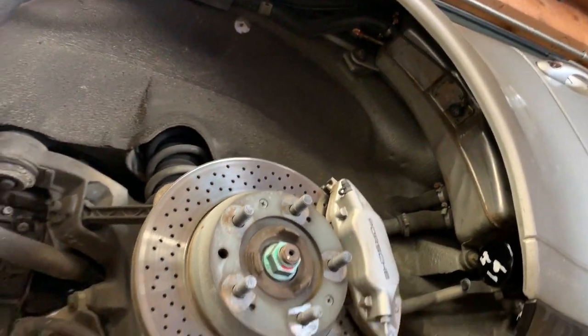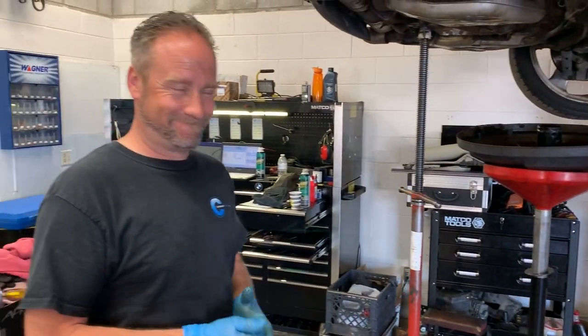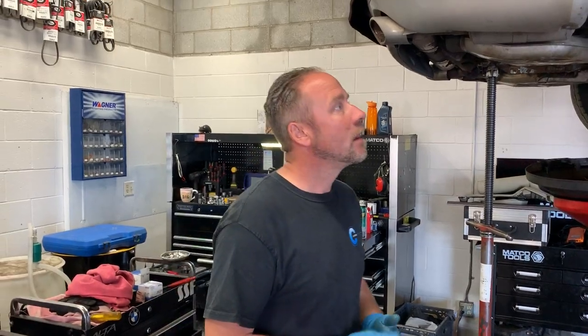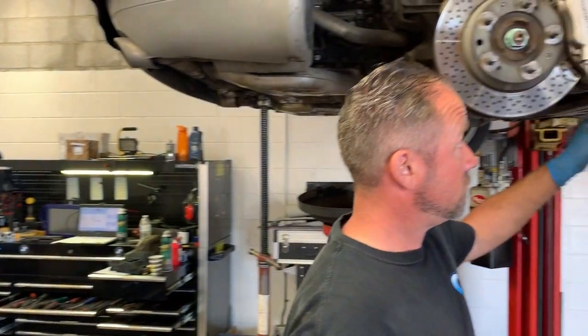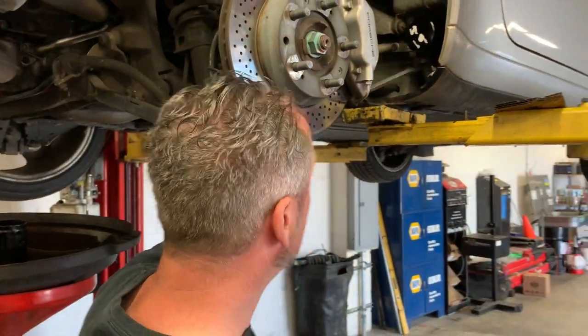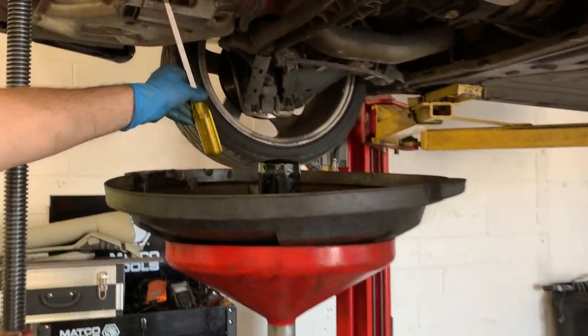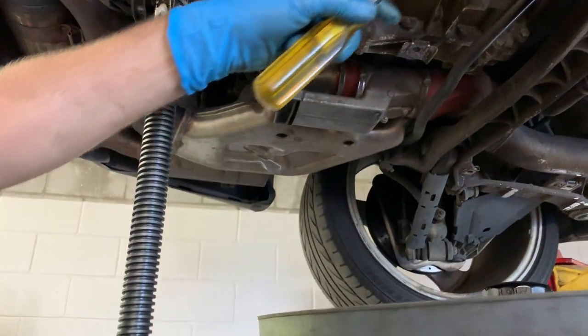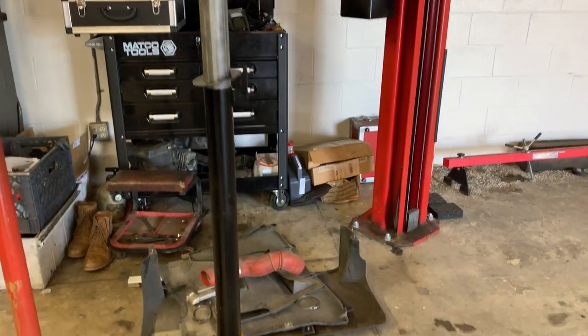To let us know more we have our German car expert Anders. It's very important that we do that external oil filter on the tank — there's a drain right there, there's also a drain on the actual engine right there. You've got to remove this pipe and the heater box to get to that oil filter. Very important to get both and drain both things.